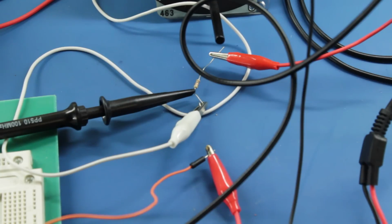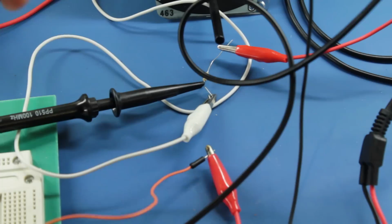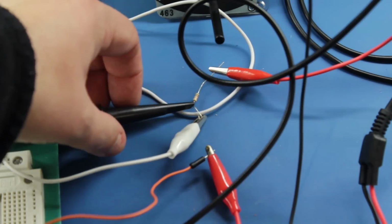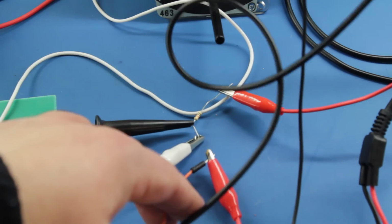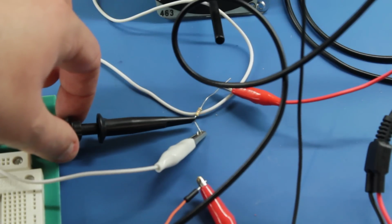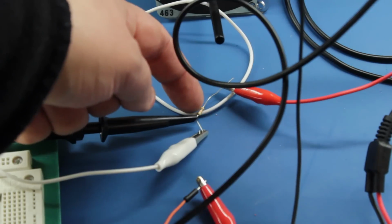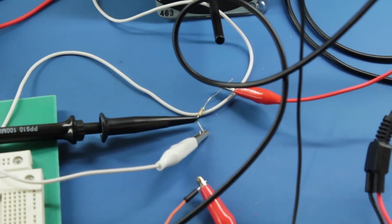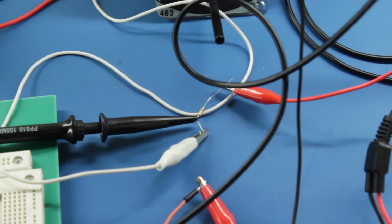Now unfortunately this is getting a little bit messy here, but you should be able to get the gist of it. This is my line coming from the ECU pin on the back of the speedo. It's going through a 10k resistor up to a plus 12 volt supply. I've got my oscilloscope probe here, and that's probed on the speedo side of it. So in other words, there's going to be a voltage drop across this resistor of 12 volts when the speedo is asserting that transistor, or pulling the line low. When it's not doing that, obviously the oscilloscope is very high impedance, so it will drag the line high, so we'll be able to see the plus 12 volts at that point.